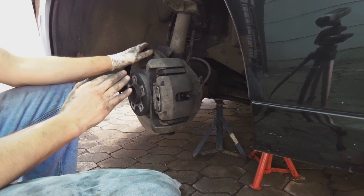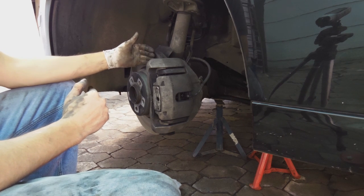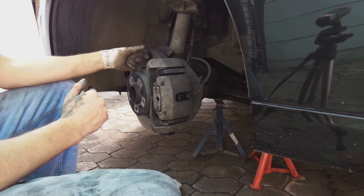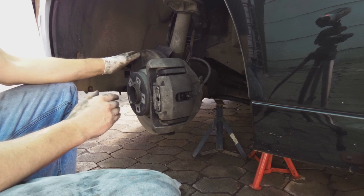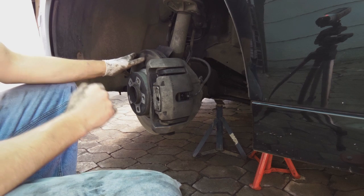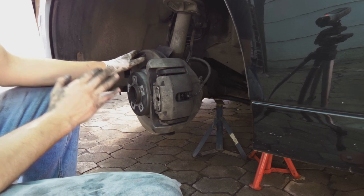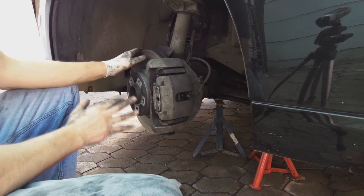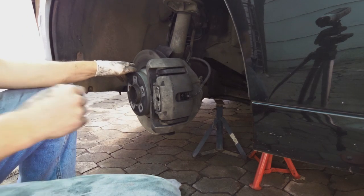You'll find that it might not have the best grip for a little while. Once the pads have started to mate nicely with this disc, and also clean the layer of dirt off, it will progressively get better and better. So don't smack the brakes immediately. It won't feel amazing for the first 100 k's, and that's why you gradually hit the brakes.